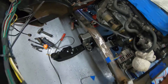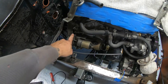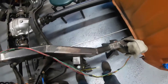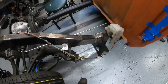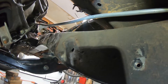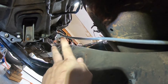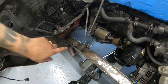I made these lines way too long because there needs to be some rubber bit between the fuel filter, which mounts right there, and the hard line. The hard line will mount down there, and there's lots of extra line back here too — it only needs to come to right here, then rubber lines up to the gas tank. There's the second block right there, and one back there. I'm gonna do another one on top of the transmission mount, and then that last one will terminate right there with the AN fittings.